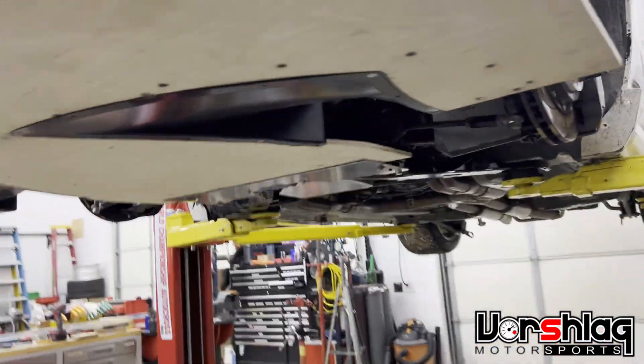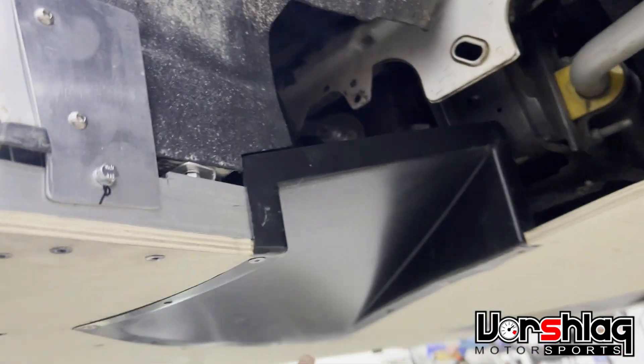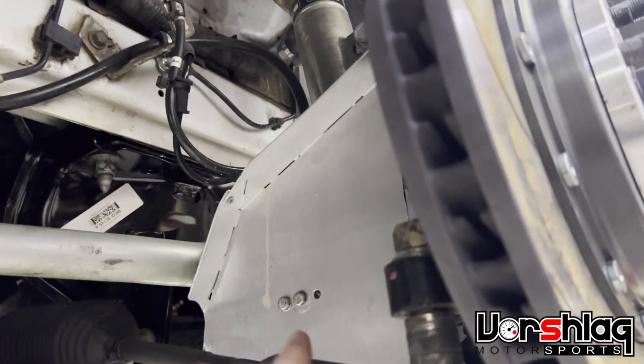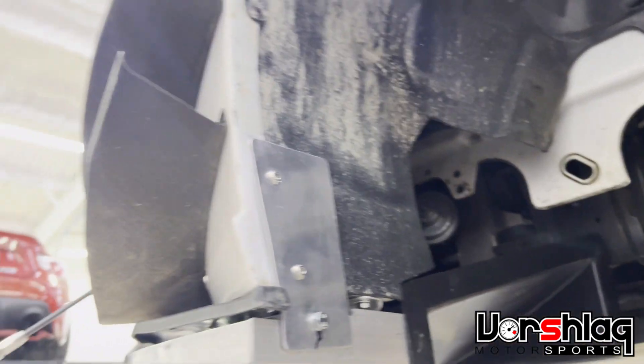On this particular splitter, we use Professional Awesome large splitter tunnels or ramps — these can generate a good bit of downforce. They're quite large, and we have them aimed to point at our brake deflectors that push air through the rotors for cooling, so we get a secondary benefit from that.